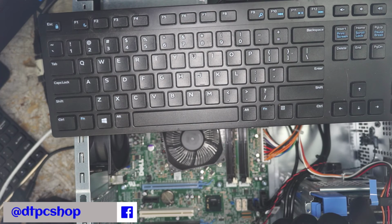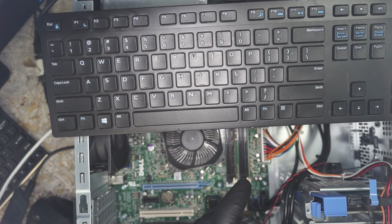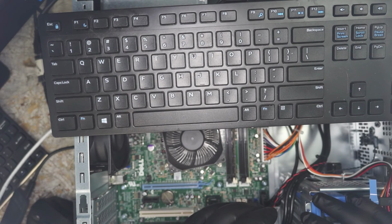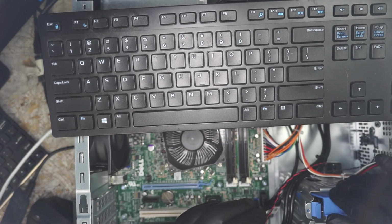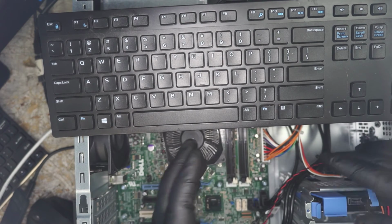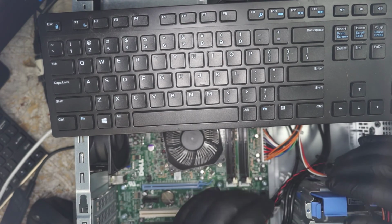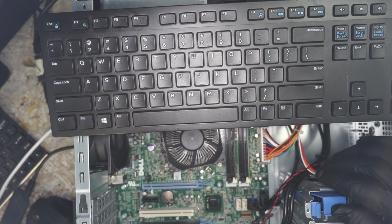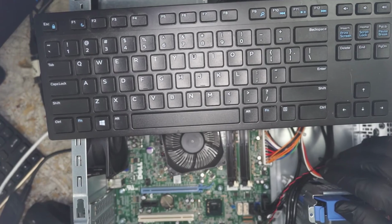Or B, I could take this drive and their operating system drive to our all-in-one, what is that thing, Acer over there, or possibly even the Dell. I just have to install it still, and do a clone of this mechanical spinny drive over to the SSD. They're both 500 gig drives, so it would fit, it would work. Even if the SSD was smaller, cloning would still 100% work.